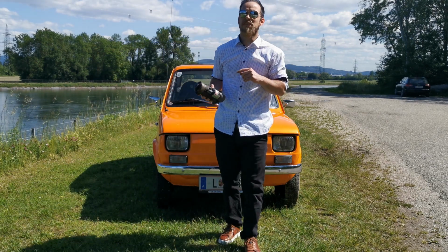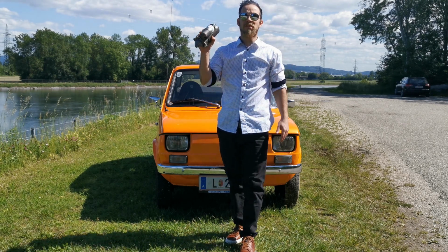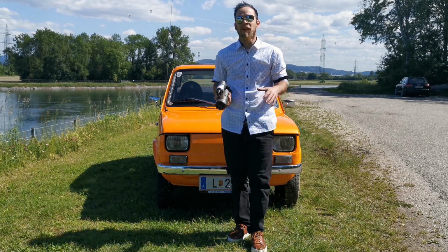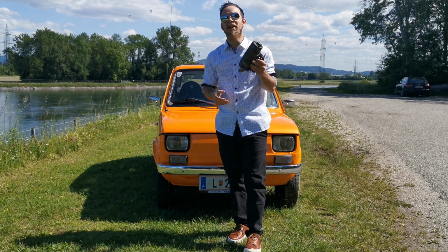With the new fan belt installed, a new pulley and 3 screws back in their place and a new starter, I hope to have sorted out the technical issues that the car currently had, and I hope that there won't be any further issues for the time being.